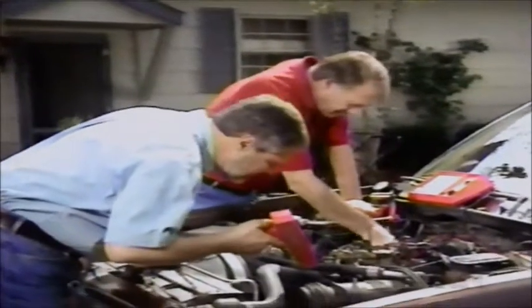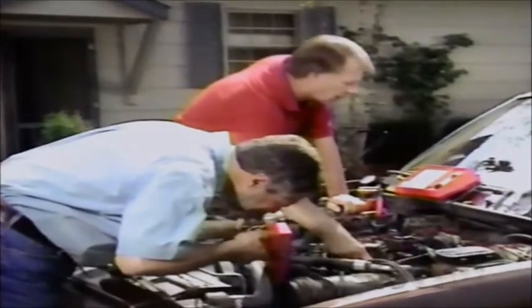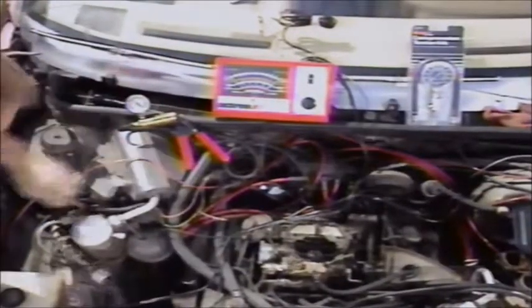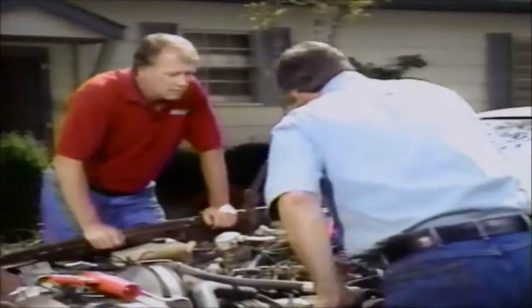The vacuum's a little low. You can really hear it - I can hear a vacuum leak. I see some have been chasing that misfire; they've already replaced the plug wires. I'll bet we'll find a plug that's fouled or something like that. I'll bet they didn't replace the spark plugs. It was not easy to get to them.